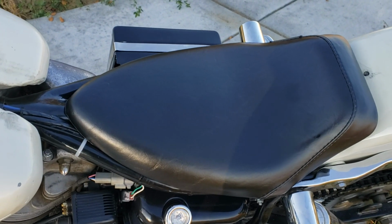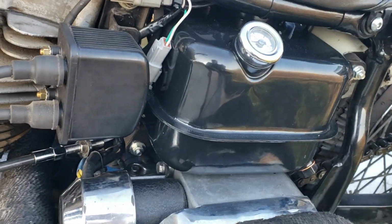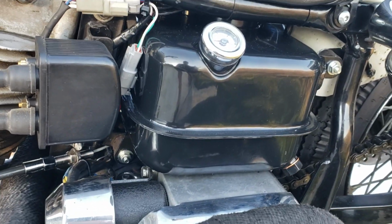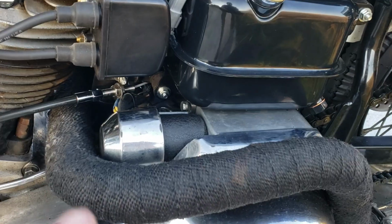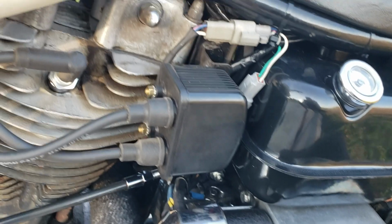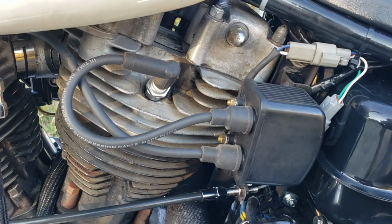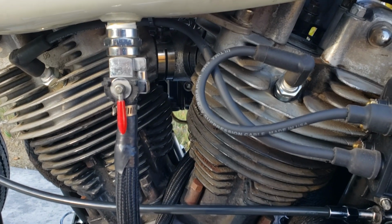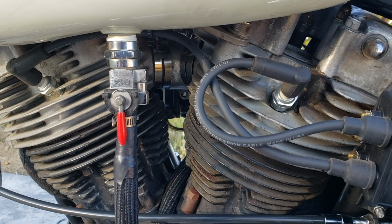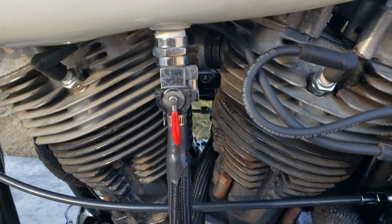It's got a LaPera bare bone seat on it. Brand new V-twin manufacturing oil tank. There was an aftermarket chrome oil tank on it that was leaking. I wasn't a fan of it. Brand new starter relay. It's running an Ultima ignition. Brand new electronic ignition. Have aircraft stainless steel style clamps on the intake and new rubber, as well as a new carb bracket, S&S carb bracket.